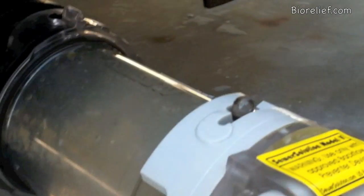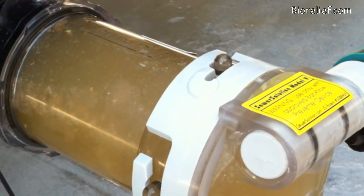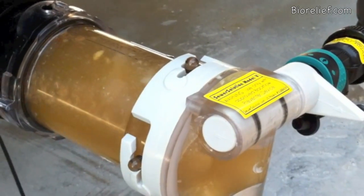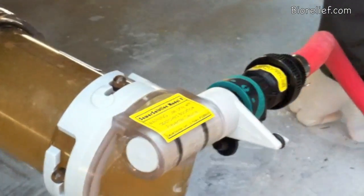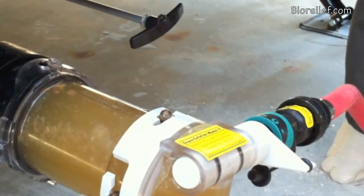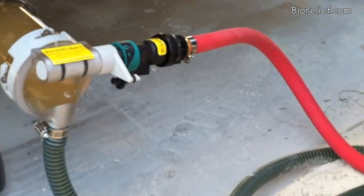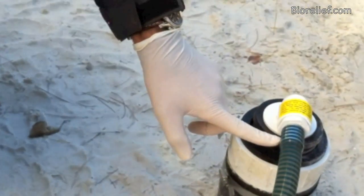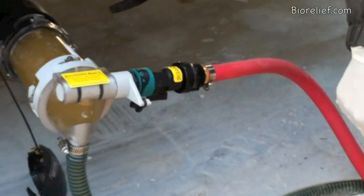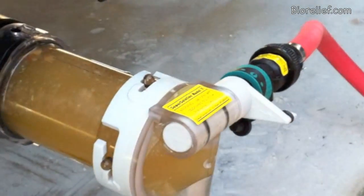Off it goes. And there goes the black water, just coming down. As you can see, it's not really black — it's actually brown. I went ahead and added this clear elbow over here, this clear arm, so you can see what's going on. Here comes some toilet paper going right down the Sewer Solution. And you just sit and wait. Now, this takes longer than your regular three-inch stinky slinky because it is just a one-inch hose. I want to note that this is pumping uphill — the bottom of this at our sewer is actually about the midway point of our elbow over our sewer, so it is actually pumping uphill. So we're just going to let it empty out those tanks, and when it's done I'll show you how to use the self-cleaning function.